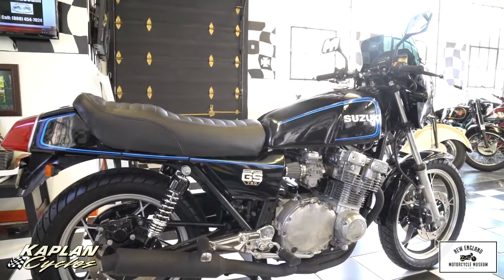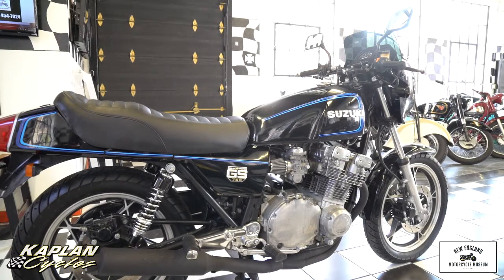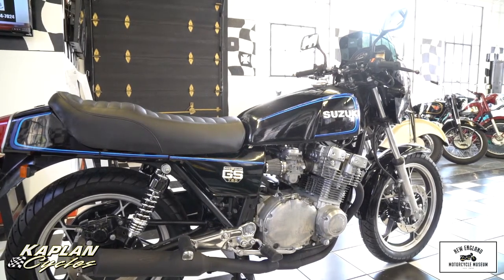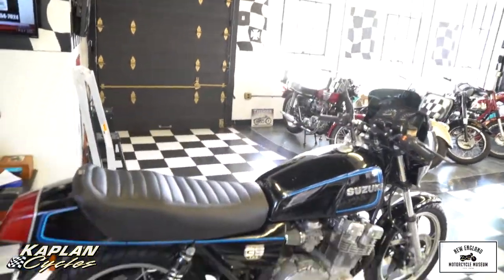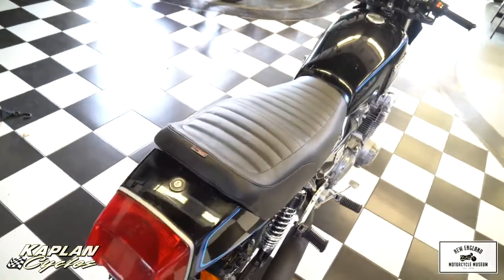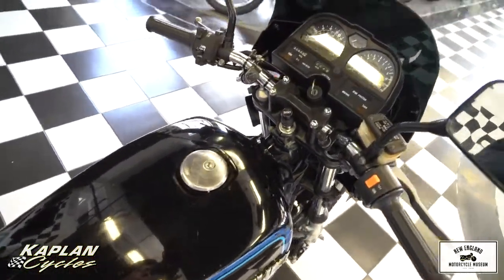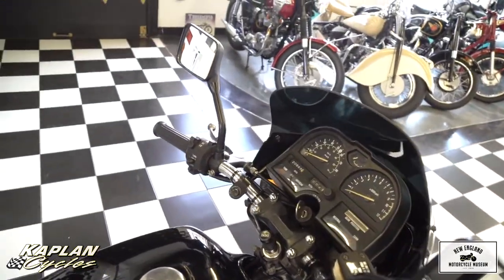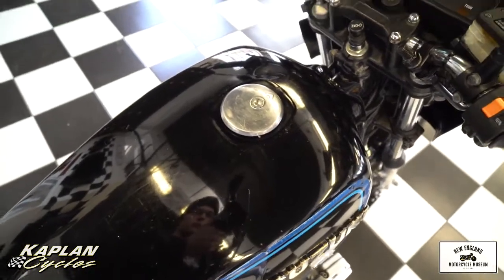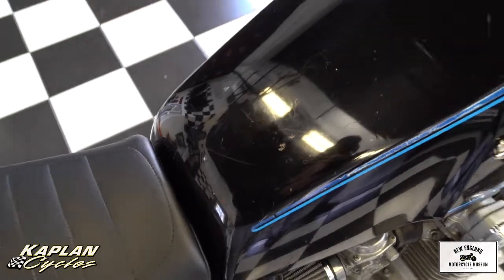Brand new carb rebuild kit with all the jets, along with the Dynojet Stage 3 kit, and all the gaskets and everything else. 52 millimeter tapered air filters, custom chrome free flow canyon style air filters. 5/16 inch black rubber fuel lines, 1/4 inch black rubber vent lines, and 3/8 inch black rubber hoses. All the hoses are new on the motor. Brand new K&L caliper rebuild kit, brand new brake line crush washers, new Bel-Ray DOT 4 brake fluid,